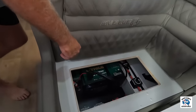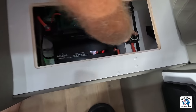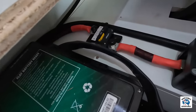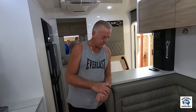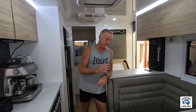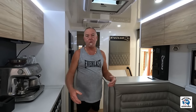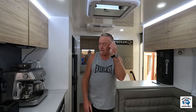It's just an inverter in here — a 2,500 watt 12-volt one. It's got an isolator switch and a circuit breaker. We're just going to see how we go with the 300 amp hours. 400 would have been a lot better but it's a lot of money. I've got to buy another 300 which makes 600 — might be a bit overkill. We did try the aircon last night and it does run it. It's not going to run it forever — probably a couple of hours — but we're not really trying to travel that way just yet.